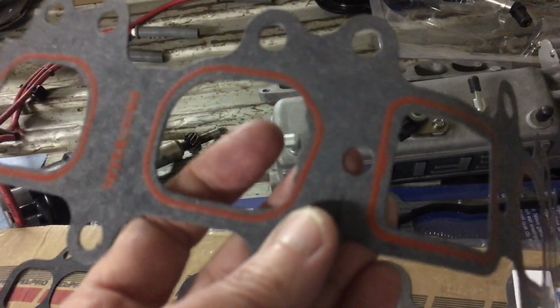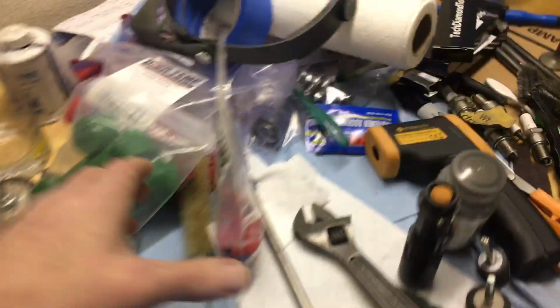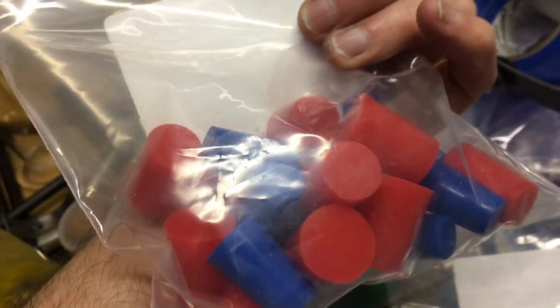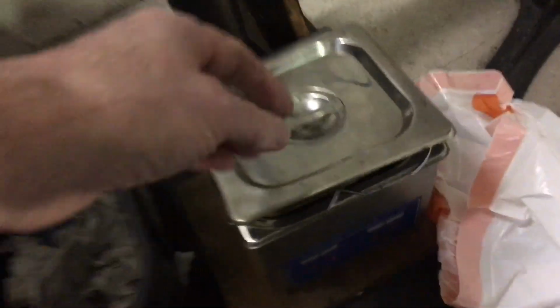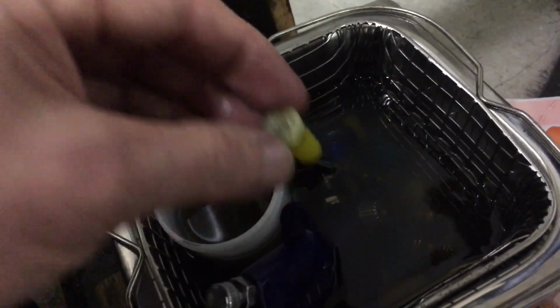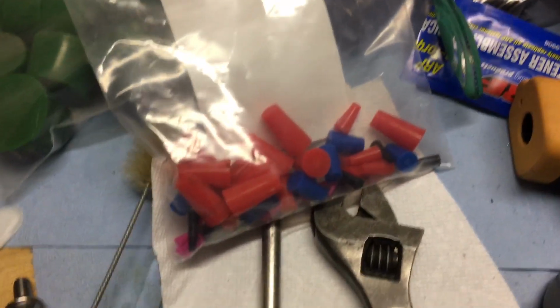Then to put this up to the manifold, I have this stuff here, and I'll link these in the description for anyone who's interested. But these things are really terrific. They're little high temp silicone plugs, and they come in various sizes. This is the small size here. Over here in my little cleaning tank, I've got these little yellow guys, and these are perfect for indexing the gasket to the manifold and holding it while you scribe a line or work. So I've found those little silicone plugs to be absolutely indispensable while working on the motor.